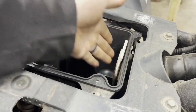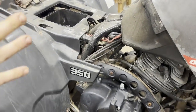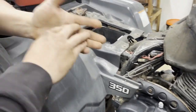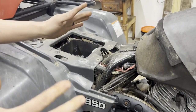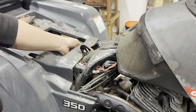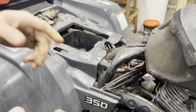On the back side of your carburetor is your intake boot, which goes into your breather. You can take the palm of your hand and cup it over this. What that's going to do is act like a full-on choke — it should be sucking on the palm of your hand. If it's not doing that, or if it's blowing out instead, then you've got an issue.